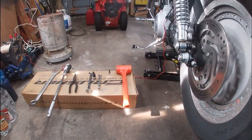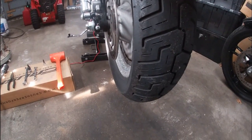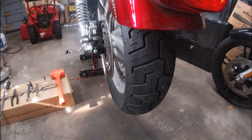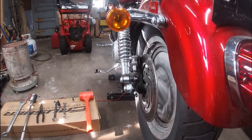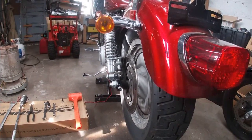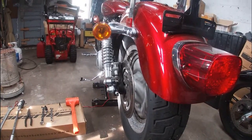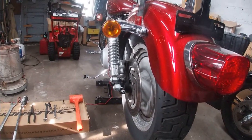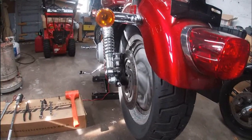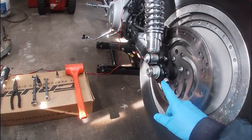Spinning around here, we've got a hydraulic jack with a piece of wood which I'll put underneath the tire. I'm up pretty high on the jack and I don't want it to just drop when I finish getting the axle out, so this way it'll be supported. You can see the calipers — the caliper stays. I don't know why so many guys remove their caliper on this job; it isn't necessary. The disc will slide right out of the brake caliper, provided you don't press your rear brake pedal. The half-inch wrench is to back off the adjuster.